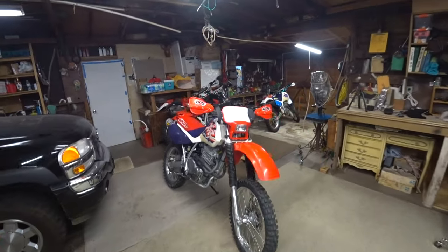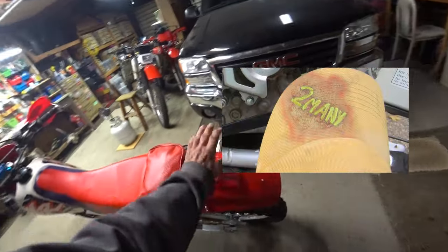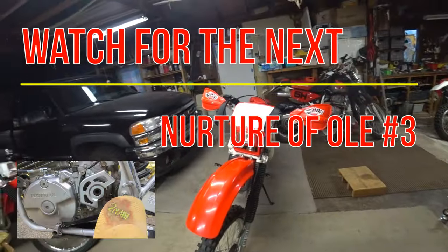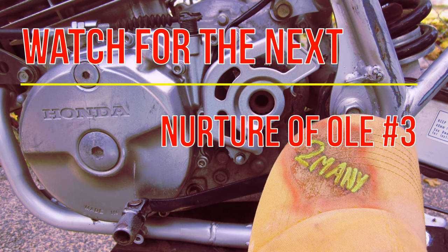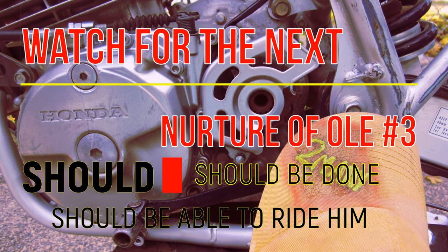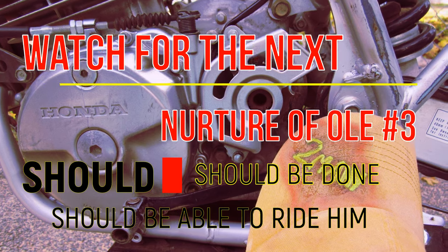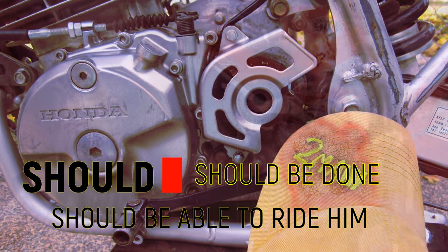No headlight. Or tail light. We're not putting any power out to that stuff. Next time I take the seat off, I'll have to look into that. Runs good. So now the question of the jetting. When I had the carburetor apart, I put it back together with a 162.